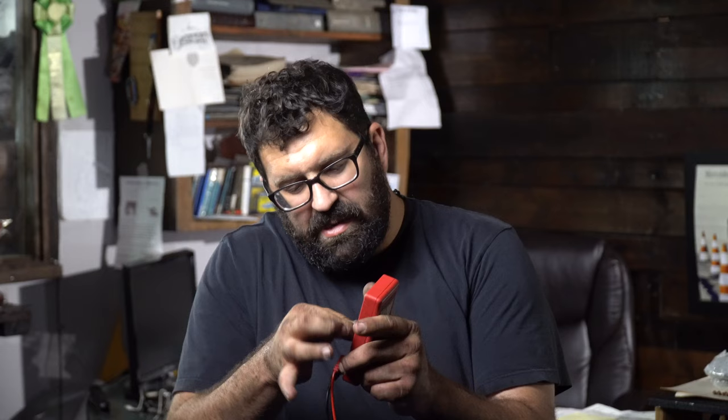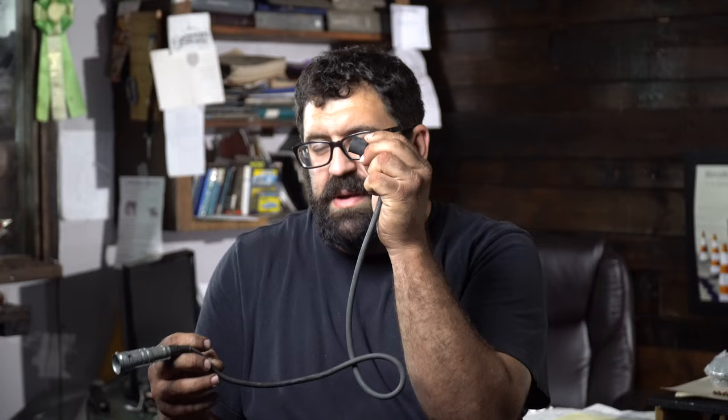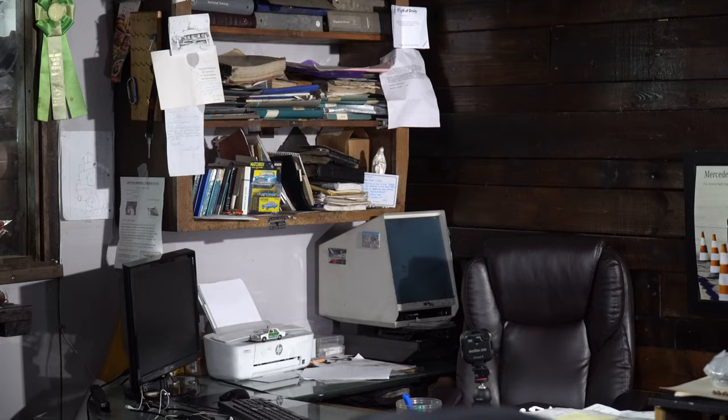How do you resolve this kind of problem? The easiest way is by checking your spark plug wires to see if they have good continuity, because this will help you either repair the plug wires or rule them out. You're going to need an ohmmeter — I usually set it on 2000 ohms. I got this one at Harbor Freight. The reason I set it on 2000 is because one end of the wire should have no resistance, and the other end should be 1000 ohms of resistance.